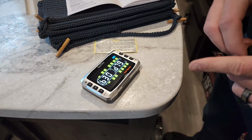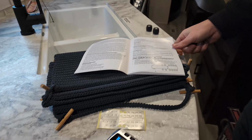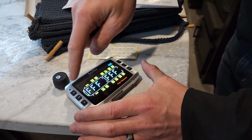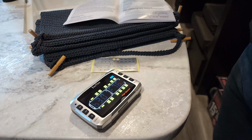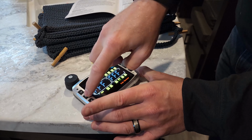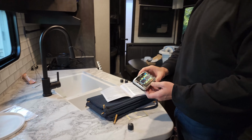Okay. We're going to go to T5, which is on the next axle right here. You're just going to match these with what you labeled, and you're going to match it to the flashing tire on your screen. I'm going to press and release. Perfect. T5, and we have one more, T8. We're going to go down to the T8. You'll find that on the diagram. Press and release the code. Okay, perfect. So we have synced the 4 tires.